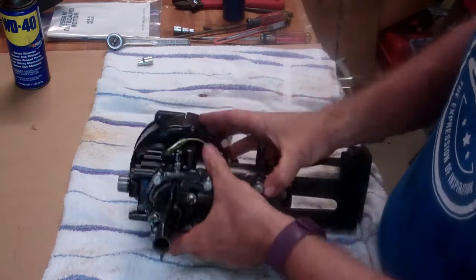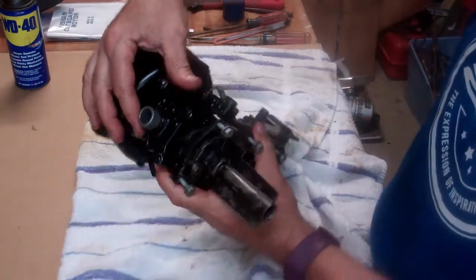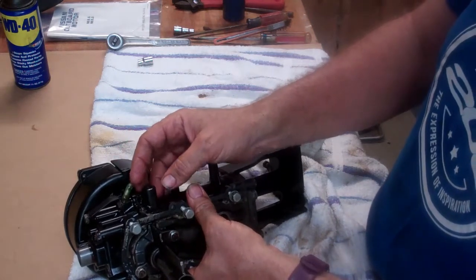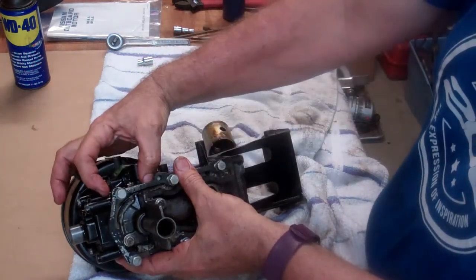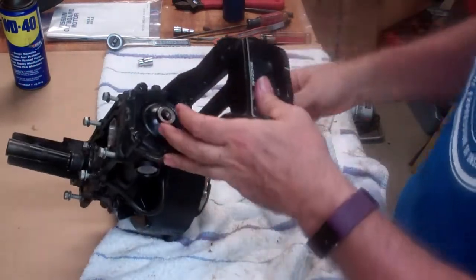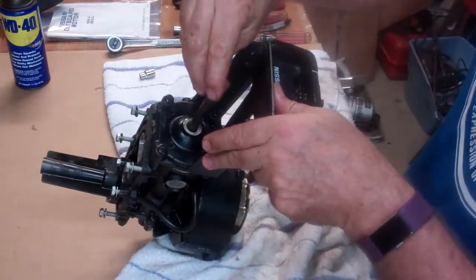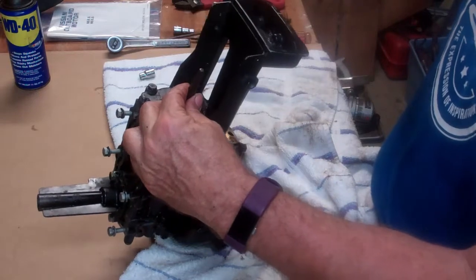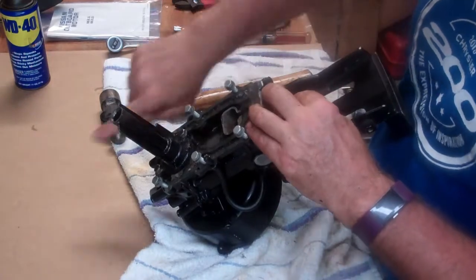By taking these bolts off, I was able to separate the halves. I was able to shoot oil into the ball bearings and get the crankshaft moving a little bit and separate the halves. The flywheel I successfully pulled off. Then I took a punch — this is really your last resort — stuck it down in there and started banging on it with a ball peen hammer, gently at first. It was moving a little bit. I added more oil, moved it a little bit more, until eventually I was able to punch it all the way out.